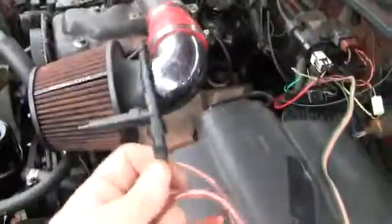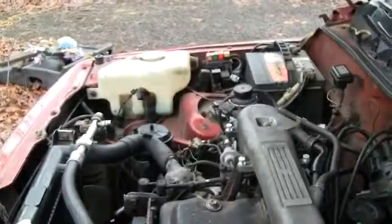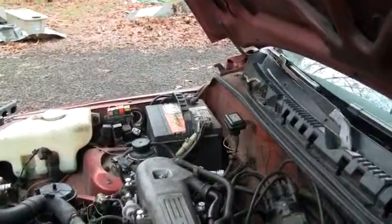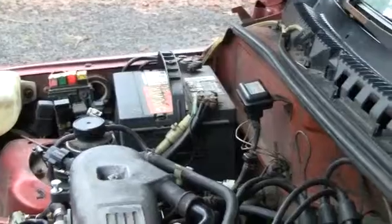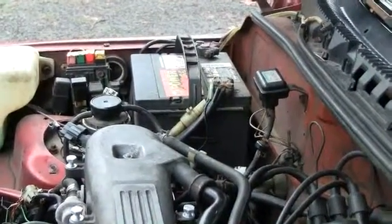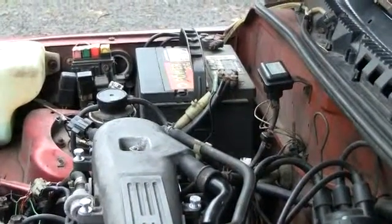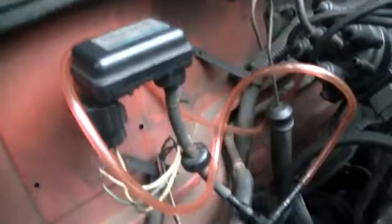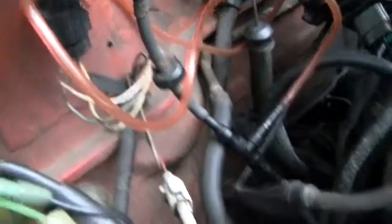Here's my vacuum line - there's no vacuum over here. I'm gonna go over to my vacuum line here. I'm just gonna tap into the side here, over there someplace. I could tap into the MAP sensor - right there. That's my MAP sensor. Still, I guess it's not using that anymore, except maybe for shifting. No wait, shifting is all mechanical on this tranny. But the computer does use the pulses to keep the injector running, so I need that. Okay, that's the old MAP sensor. I think that thing's a filter - I'll tap the T right in there.